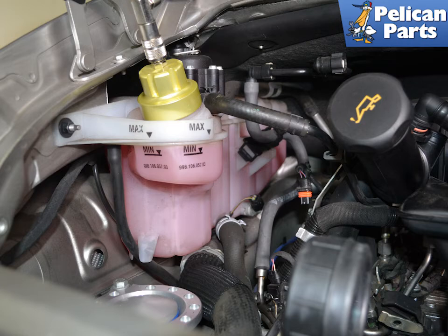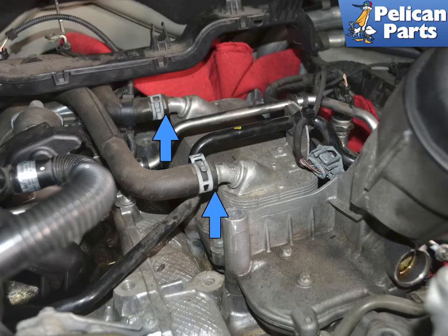If the pressure is dropping, first check the reservoir for leaks, then all of the hoses and fittings attached to it. The engine oil water cooler, indicated by the blue arrows, can be a cause of leaks. You will not be able to see this, but if fluid starts dripping down from the top of the engine, this is probably your source. Please follow the link provided at the end of this video for additional assistance with getting access to your oil cooler.